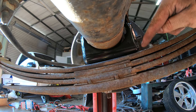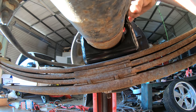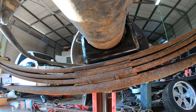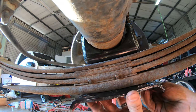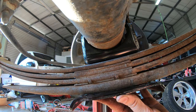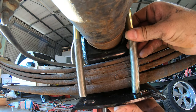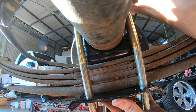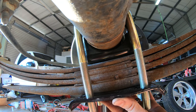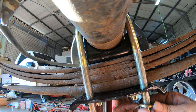Make sure that the flip kit is sitting level and flush — no gaps — and then slide your U-bolts over the top. Here are the supplied U-bolts. You also have the lower piece. Make sure when you put it on there that you spin it so it is flushed and centered with the frame, rear end, and leafs. Slide your U-bolts down through the top and through the holes on both sides. Then get your supplied washers and nuts and put them on all four.